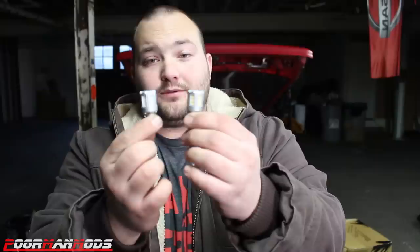Now, there are a couple bulbs in this video that I highly would not recommend, but these two I would definitely recommend. You know, this one is cheaper, the white one. The red one's a little bit more expensive, but I think the red one is the best one out of all of them. So I'm gonna go with the red Sylvania 1157s. Their white one is very close behind, and the other bulbs, well, they all suck for this car, to be frank. The one that Tony has in his car, they might be brighter, but the difference from brake to taillight, I don't think that's safe.